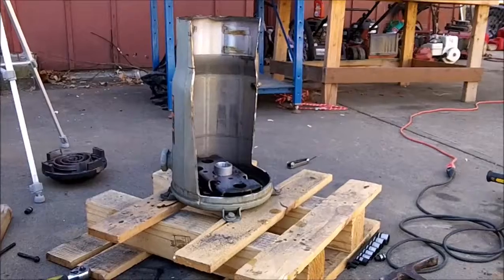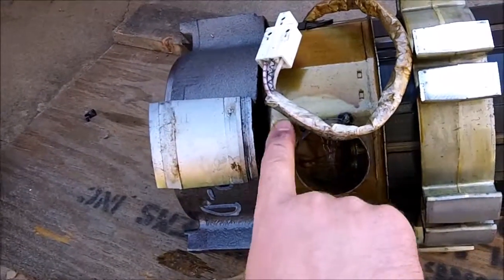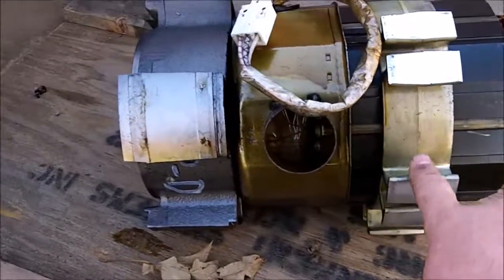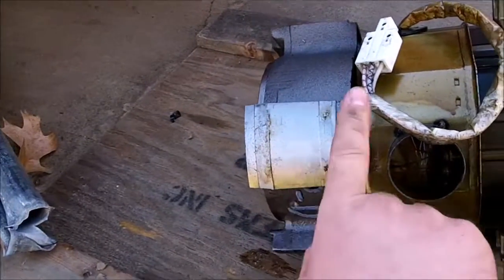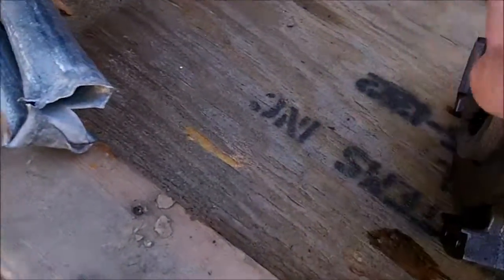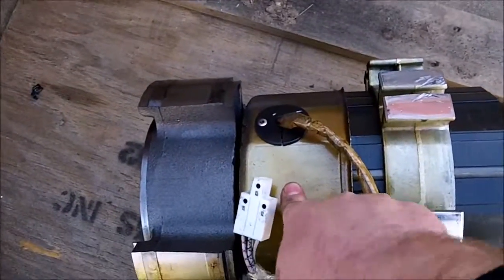I finally got it out. I had to completely cut the compressor housing in half because you cannot slide the bottom section of the pump housing — or the pump itself — out through the top, because this part right here interferes with the motor rotor. So when this is assembled at the factory, before the rotor is inserted, you have this part put on first — this part, this part, the motor rotor — and then you get this eccentric counter-shaft weight pressed on. So in order to slide the stator off and everything, you have to disconnect it from right here.